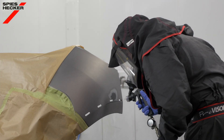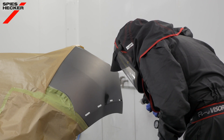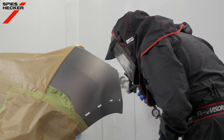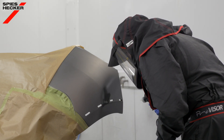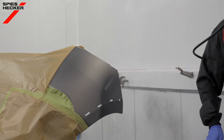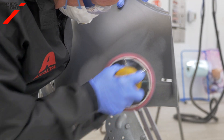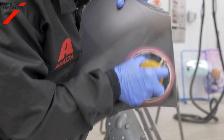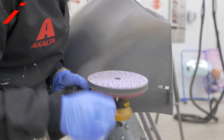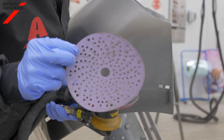Our main focus here was wet-on-wet application of new parts, but this new plastic additive can also be used in the low energy sanding surfacer, and again has a direct-to-plastic application — there is no need to apply a primer beforehand. This makes the surfacer flexible without compromising on performance or process. The super-fast air dry performance is not affected and it can be sanded from just 20 minutes depending on your climate, and it sands just like it does on metal parts — not rubbery as you might expect for an elastified coating.